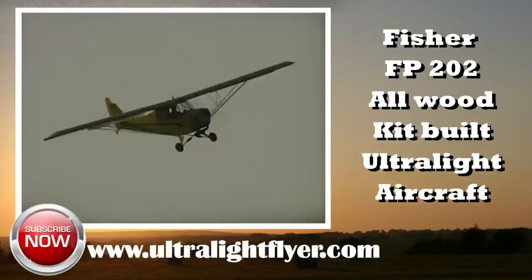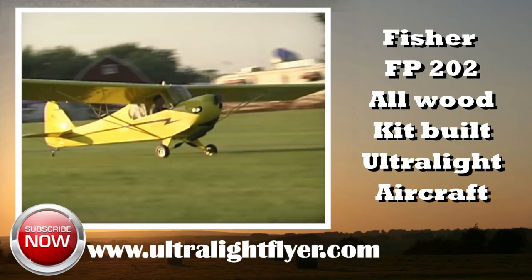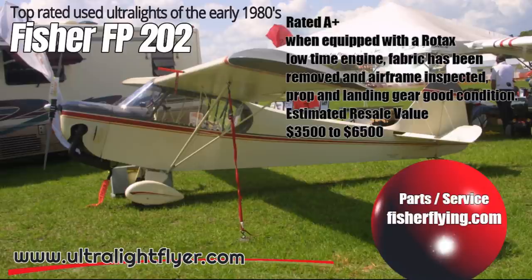If considering purchasing a used Fisher FP202, it is the Ultralight Flyer's recommendation that the plane's fabric be completely removed and the airframe, wings, landing gear area, and control systems be thoroughly inspected. If the history of the engine is unknown, it is recommended that the exhaust be removed and the pistons inspected for wear and seizure. At the time of production of this video, the Ultralight Flyer would estimate the value of a used Fisher FP202 Koala to be $3,500 to $6,500.